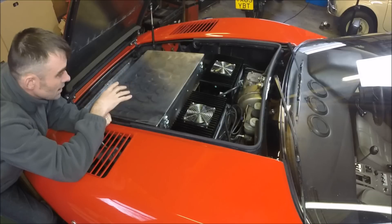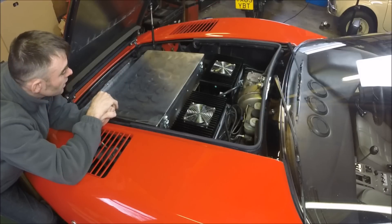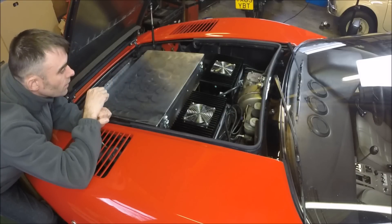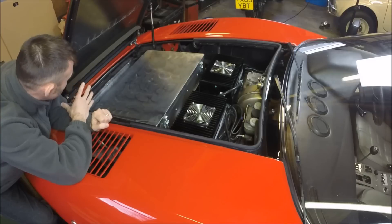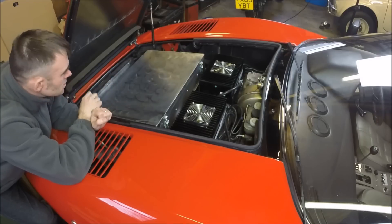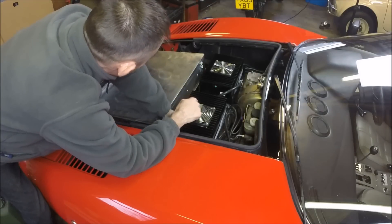At the front, we've got another battery box with eight LG Chem batteries — a 20 kilowatt hour battery pack. Combined with ten in the rear at 25 kilowatt hours, that's a total of 45 kilowatt hours for the car. We've also got the chargers in here. Buried and not easily visible is the electric vacuum pump for the brakes. We've also made a panel at the front that fills the void where the old radiator used to be, keeping the British weather out of this area.